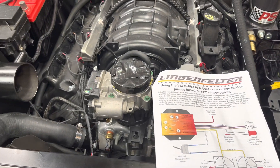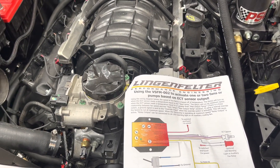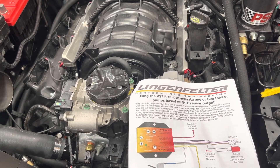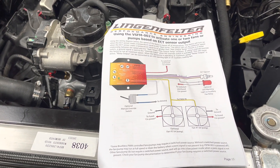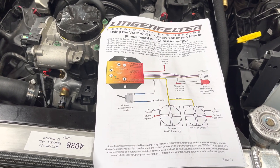We use this in all of our truck Hemi conversions — the 392s or 6.4s, and also the non-VVT 5.7s. This fan will work in anything really, but we have it set up for our application to run a pulse-modulated Camaro fan to keep our engines cool.